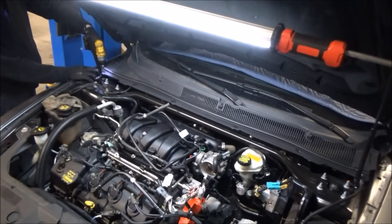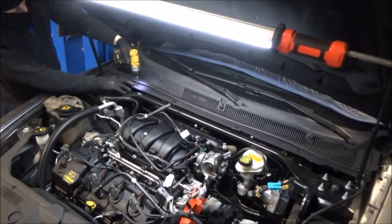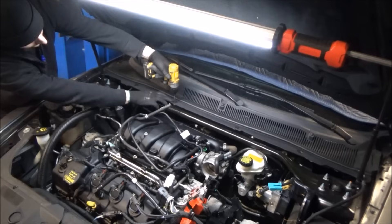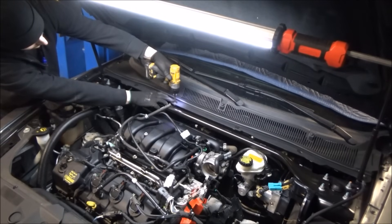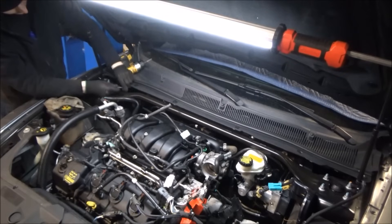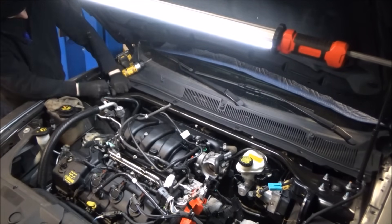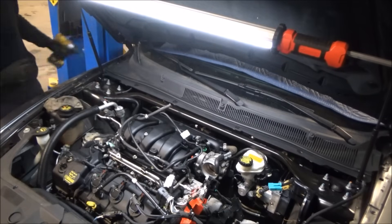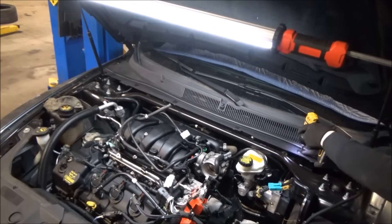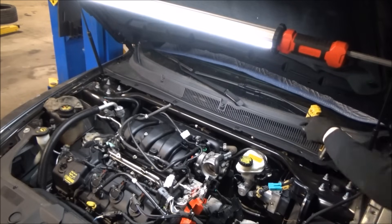What I'm doing here is starting to remove the cowl. When I pull this powertrain, I'm pulling the entire wiring harness with it, and the engine computer is up underneath this cowl. For the most part this thing's held on with the plastic fasteners towards the front — I'm just unscrewing those. I also just disconnected the washer fluid feed to the nozzles. Coming around the other side doing the same thing, getting rid of these plastic fasteners, then we start working on the wiper arms.